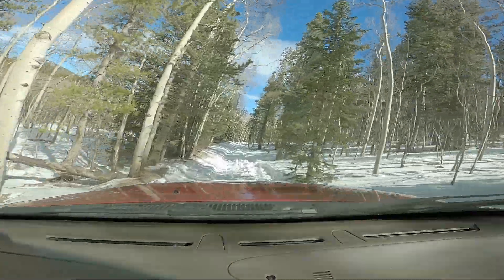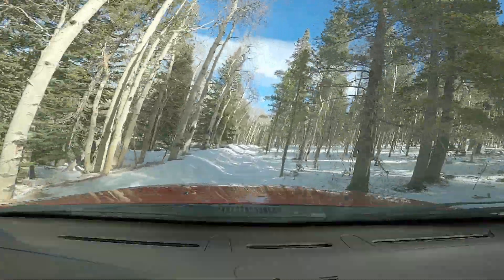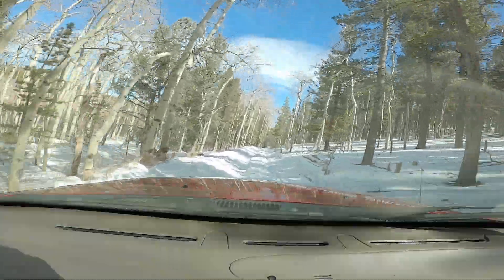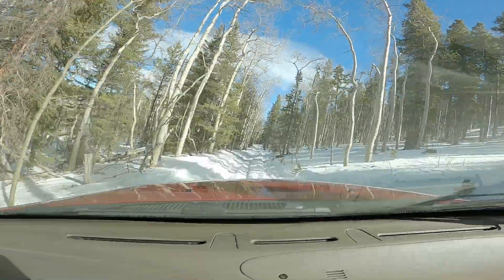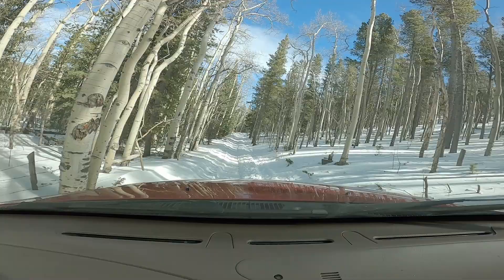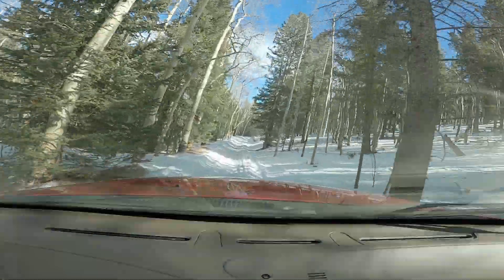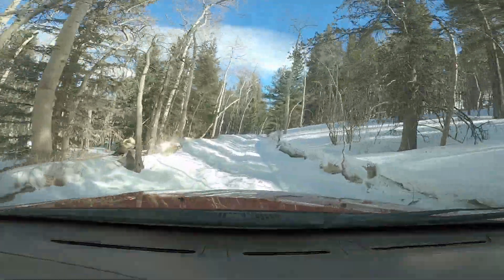On the street in the snow this is where it gets a little different. They act like a limited slip differential for the most part, but they will hunt for grip a little better. If you have it in two-wheel drive and you try to break traction it'll go back and forth — it'll grip on one side and grip on the other — so it hunts for traction a little differently than a limited slip. A limited slip just kind of locks and you'll go sideways.